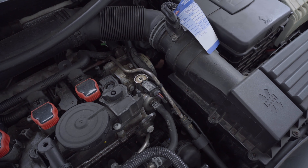The reason is they have four direct injectors and also four injectors in the manifold — they added four on the manifold on top. So they clean the combustion chamber and the intake channel with fuel. This is also very good for tuning because we don't need to add big injectors for higher power. We can use these four-plus-four injectors and have enough fuel — more power means more fuel. It's a nice gift from Volkswagen and Audi.